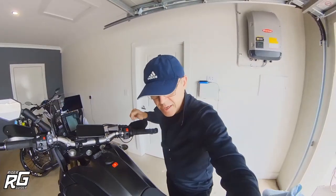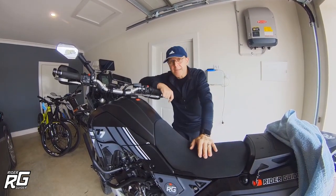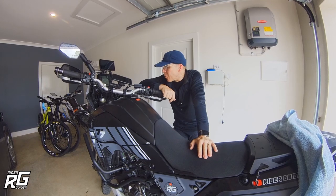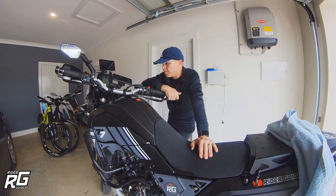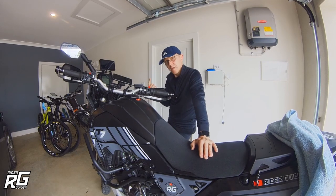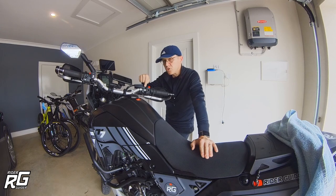This is all my brake fluid reservoir — it's all one piece. I swore, of course, as you would. So I'm in a bit of a situation and I've got to try and remove it. Local engineering companies are all busy, so I went to my mechanic over the road and asked if he had any taps and dies. The problem is, with left-hand thread, you can't just tap it out from one side — you'd need to go the other way. What we can do is use a center punch and have a go at drilling it out.